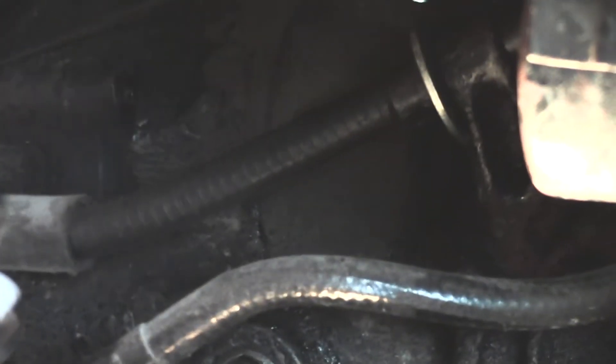To get that sag, you put a washer in there — see right where it comes out from the top, it attaches to a brace there. You have to remove your cable and then put your washer in. I tried three washers — it was far too much; you couldn't even pull the clutch cable tight enough to get it hooked up to where it goes into the clutch housing. I ended up with one washer, which worked out really good — got the right sag and everything.